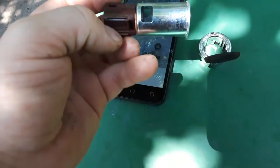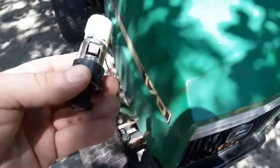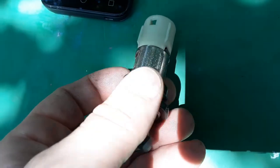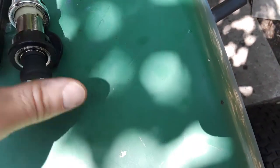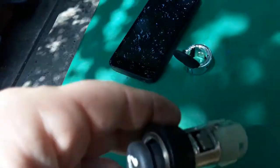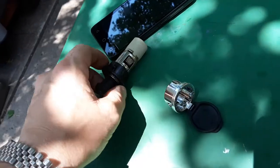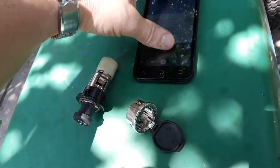The reason the cigarette lighter socket won't work on the 2011 through 2013 models is because this piece inside the dash is too narrow. The regular power adapter doesn't have any prongs, so it slides right through and clicks in place. The cigarette lighter one, however, has these extra things on the side that make it wider. If you stick it in there it won't go in all the way — it'll stick out a half inch and won't click into place. That's why I'm going over how to install this part properly.